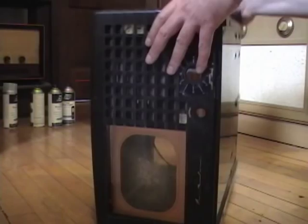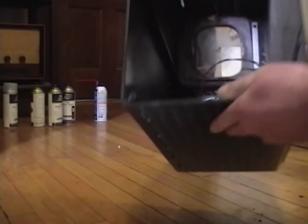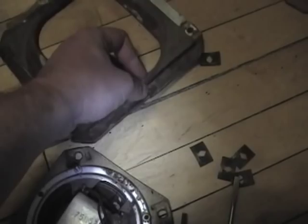Because my other cabinets are brown I can't swap out one of those channel plates onto this one, since brown against black won't look so hot. The speaker is partially covering it so I'll get that out first to see what's going on. I was pleasantly surprised to find that these metal clips came off fairly easily — I just used some flat-bladed screwdrivers to get in there and get underneath the pointy bits and pried them up, and they popped right off.